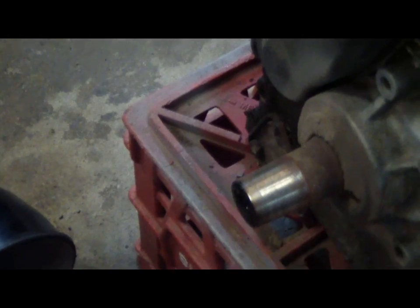I know I should have made a full video for it, but I got the clutch off. The way I done it without buying their tool is on these a 3/4 inch bolt, 3 inches long. I don't know if it has to be 3 inches, but it works. And just fill the hole full of grease, and the hydraulic pressure will push it off there, and just hit it with a mallet a few times on the back, and that pops right off.